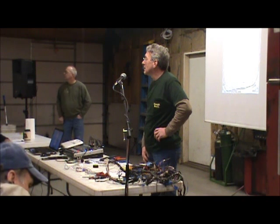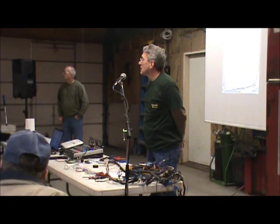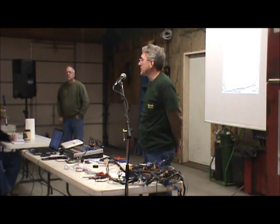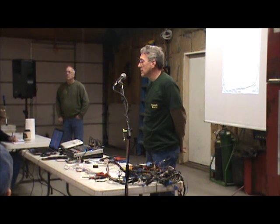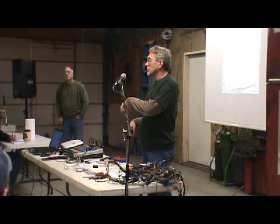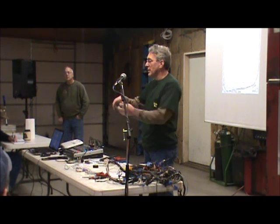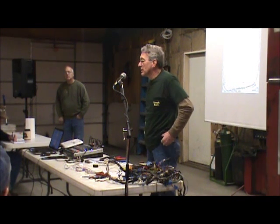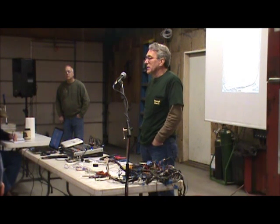You mentioned the battery cutoff switch on the negative side. Is that for positive ground cars or negative ground cars, or doesn't it matter? It really doesn't matter. You're just trying to isolate the battery. Is that a good idea to do? I mean, you've got those extra connections. All you're doing is taking the terminal off, putting this switch in between and putting the terminal back on. So you're really not undoing anything, you're just adding a switch in between. What's the purpose of it? It's just to isolate the battery.